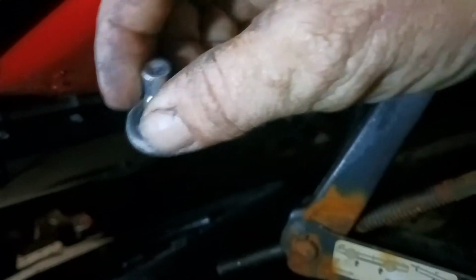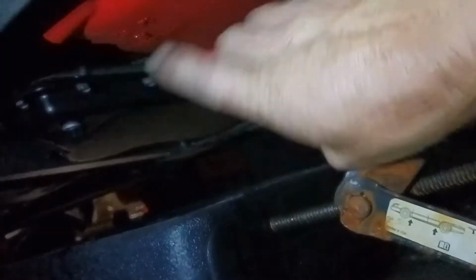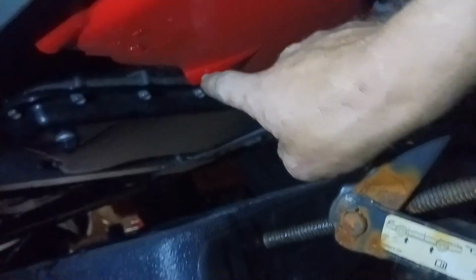Alright you guys, so I just got the oil all drained. I've just been letting it drip. I've got the drain plug here. I sprayed it with brake clean and got it all wiped off and cleaned up the rubber O-ring for the seal. And normally I brake clean off the oil pan, but since I've painted it, I'm just going to wipe it down with the rag.